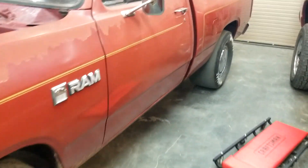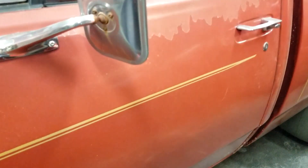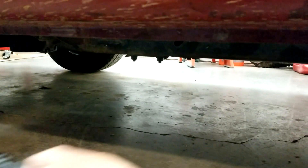My nephew-in-law, who does weld regularly, helped me with the trans mount. To get this thing where you want it, you have to put a jack under the trans — have your motor and trans bolted together, drop it in here on the hoist, and then hold the motor on the hoist, hold the trans up on the jack, and you can get everything situated where you want it.